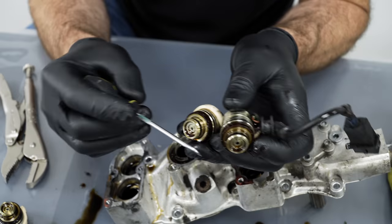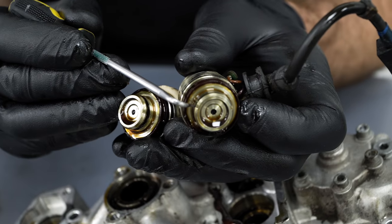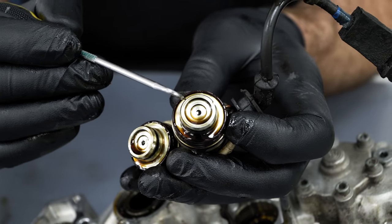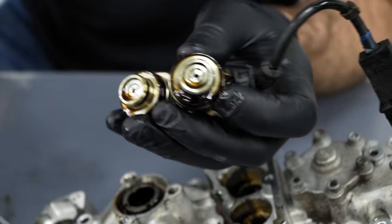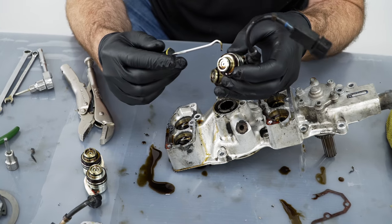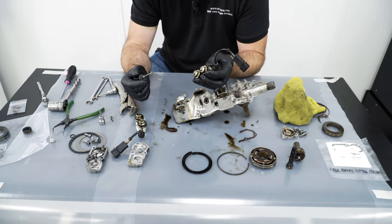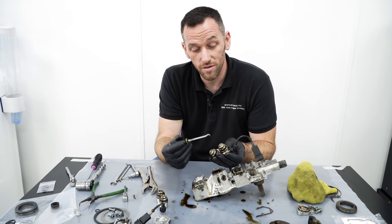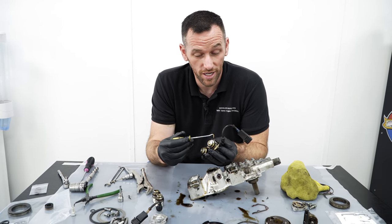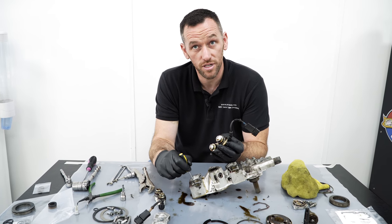And what happens is you can just about make it out. It starts to polish that edge there. Eventually, if the seal rips away and oil pressure goes past, it can snap the end of the solenoid off. If it does that, it also leaves a mark in the bore, which means you put a new solenoid in and a new seal, it never actually seals fully. That's a really common thing. We've sold seal kits to people because they've had an oil leak, but they haven't seen the damage in the bore. No matter what you do, solenoids or any kind of seals, it'll never seal because oil goes past the little groove that's machined over time in the bore.